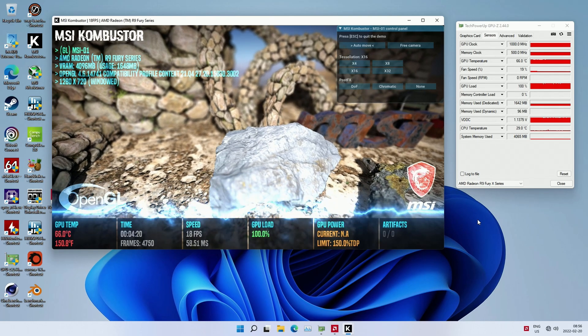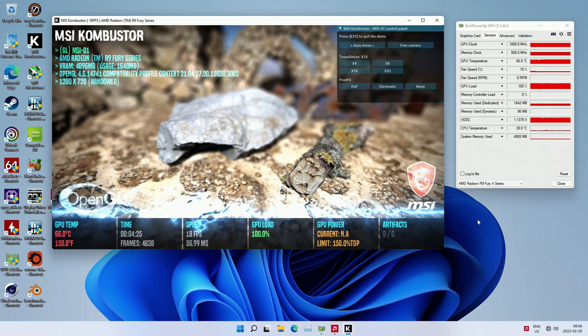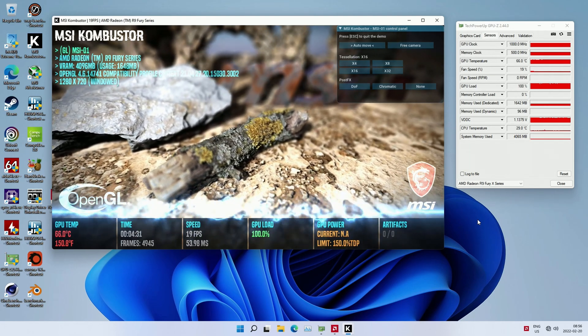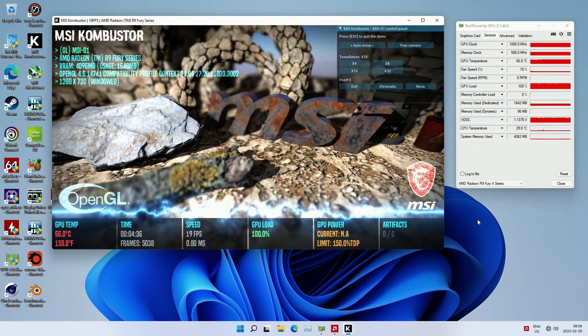On this graphics card, we have one BIOS chip per GPU, and each BIOS chip is responsible for its own GPU. It's not like the Mi 8, where you have two BIOS chips and a switch to choose which one to use — here we have no BIOS backup. If you want to try the BIOS from the Radeon Pro Duo, you need to flash the master to the first GPU and the slave to the second GPU. With this BIOS, the mini DisplayPort also works, but only if you flash the master BIOS to the first GPU.